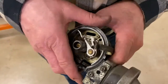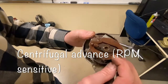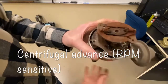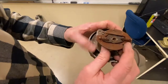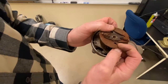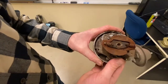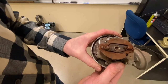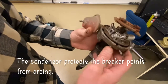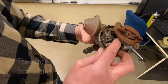I wanted to show you a car that actually had centrifugal advance weights on it so you can see what happens when the engine spins really quickly. Those weights are going to want to fly out, changing the relative position of the rotor with respect to the rotation of the distributor shaft, causing the rotor to advance a little bit and causing the spark to occur slightly earlier to ensure complete combustion. There's a condenser on this distributor too, and the breaker points look a little different on this model but they're in there as well.